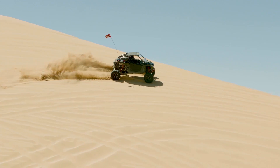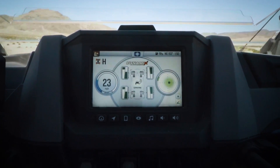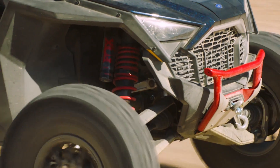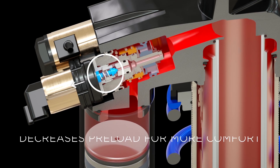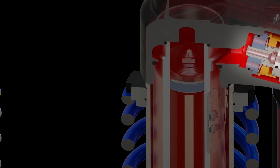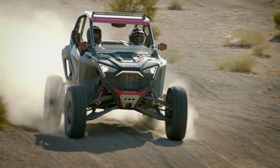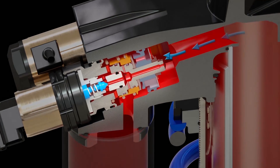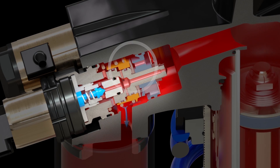While the unique oil flow makes compression and rebound work independently, it's the intelligence behind Dynamics DV and Live Valve X2 that calibrates each shock separately on the fly. During compression and rebound, each Live Valve X2 adjuster controls how fast or slow the shock moves. For the shock to move faster, it decreases preload on the spring behind the needle, which provides more comfort. For the shock to move slower, it increases preload on the spring behind the needle, which provides more support. If the terrain becomes even more aggressive, these adjustments to the needle work in tandem with the Boost Valve, which uses hydraulic pressure to progressively increase support and protect you from bottoming out.